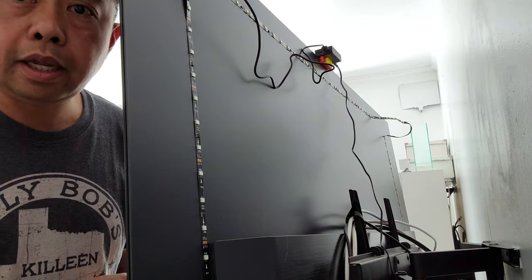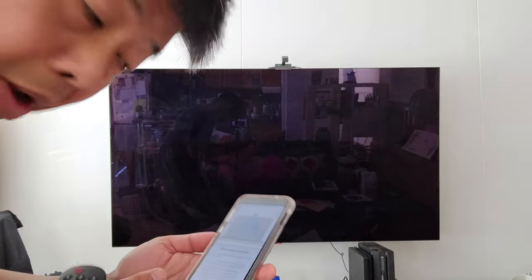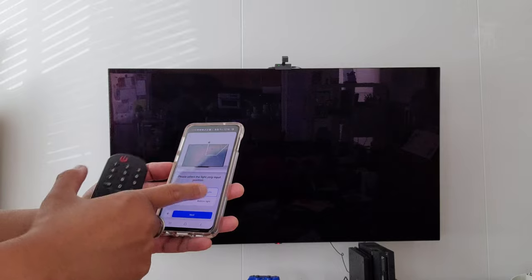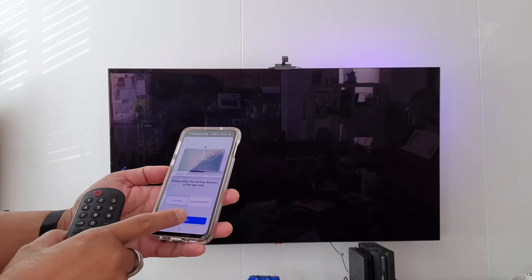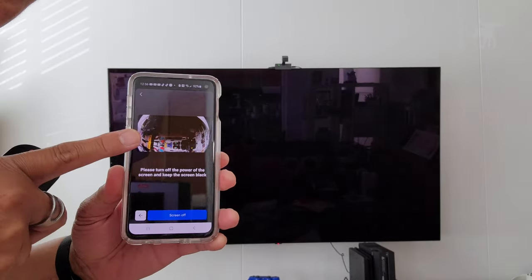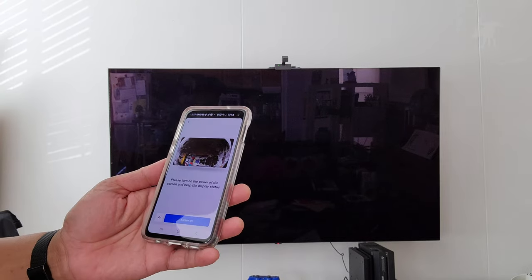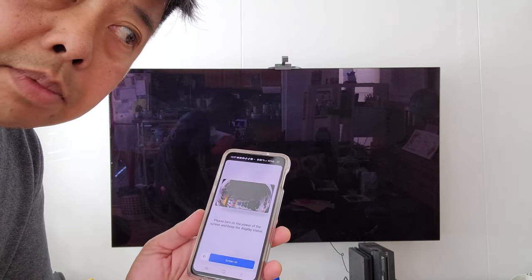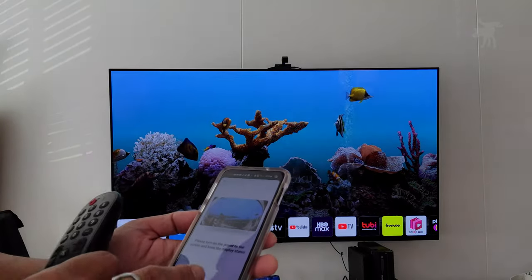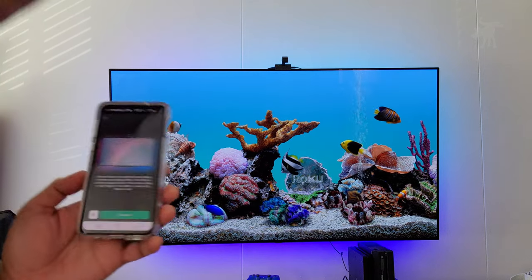We have power — plugged it in and it is calibrating. Once set up with Wi-Fi connected to your phone and the device, you go through the setup screen and tell it how you wired your LEDs to the camera. Make sure the TV is turned off — you should be able to see what the camera is seeing on your smartphone. Tell it the screen is off, then turn on your screen and put on something fairly stable visually, like a screen saver. Tell it the screen is on, and if all goes correctly, it starts syncing to what it sees on screen in terms of color.